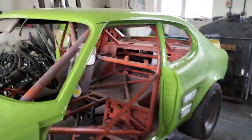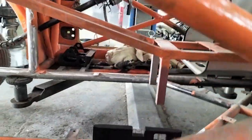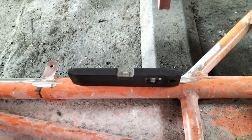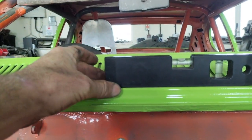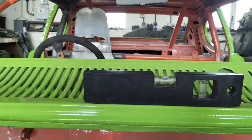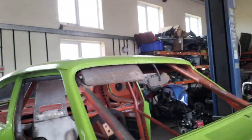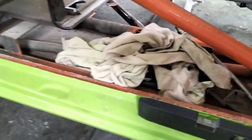What you just saw was me leveling the car up on the ramp. As you can see, the wheels are off the floor so I can get under it to fit the engine and gearbox. From the spirit level - zoom in on it - it's level front to back. It was a bit of a nightmare to get this on here flat in the center, but she's level side to side. I'm fitting an engine, not setting a chassis up, so it doesn't have to be absolutely perfect.